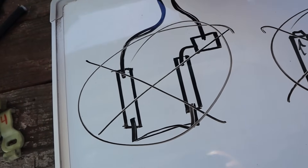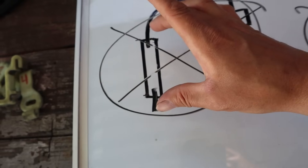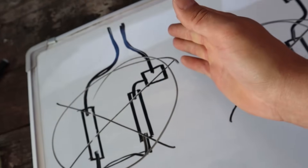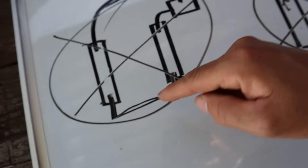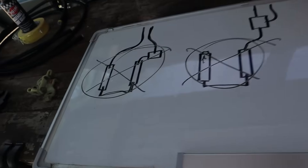If you're running a single wideband sensor, even though you have two exhaust manifolds, that one wideband gets a reading off all eight cylinders as a whole. So maybe four cylinders are running super rich and four are running super lean — you wouldn't really know. With the second setup, the first four injectors could potentially be seeing better fuel pressure than the other four. If those four were running rich and four were running lean, your AFR could look amazing because it's reading both banks together, masking the real problem.